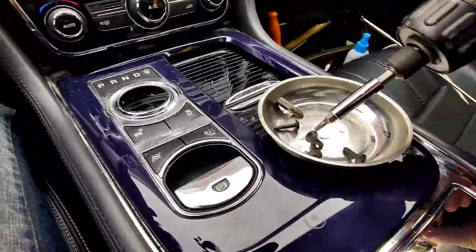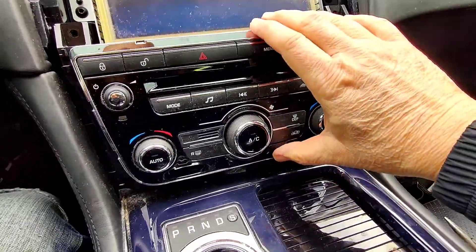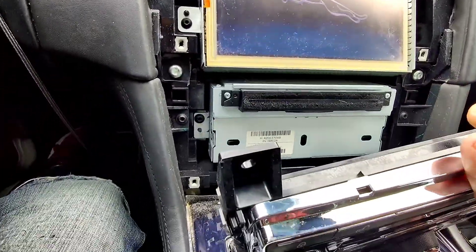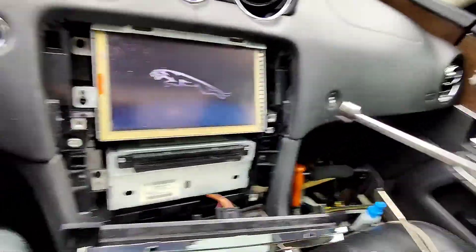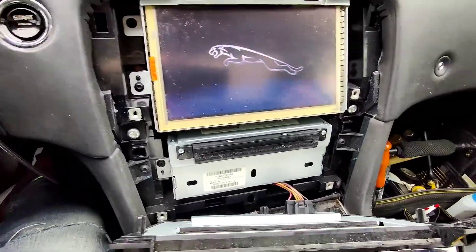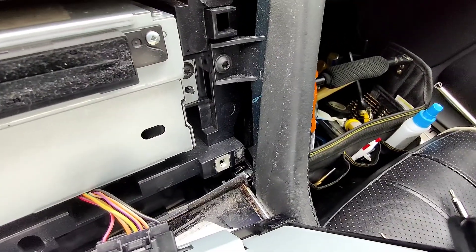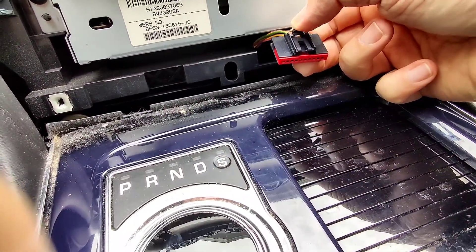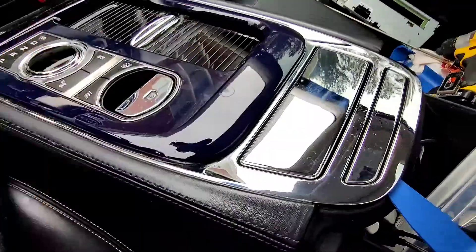We removed them. It's good to have a magnetic bit because those want to fall off your bit. I can see those clips here, so I'm going to be careful — it should just remove right out. There it goes. There's a small cable evidently attached, so I'm going to go ahead and disconnect that. I have a magnetic wand here. I see it — it's way down there, it fell in there. We're going to remove those and put them back on the bezel. I removed this connector — you just push in on this latch here and it moves from the assembly.